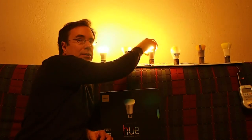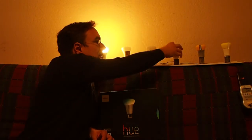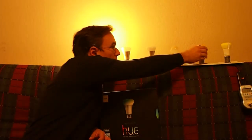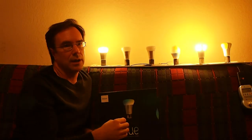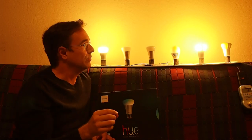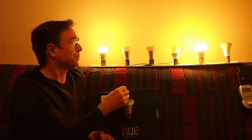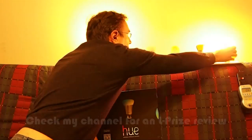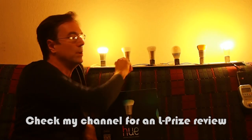Comparing it to some other bulbs: this is the Philips Ambient LED 50-watt equivalent, also an 8-watt bulb — pretty comparable, though the older ambient bulb is a little dimmer. This is the Philips 10-watt, which they call a 60-watt incandescent equivalent producing 800 lumens — you can get this at Home Depot. And finally, the Philips L Prize winner, also called a 60-watt equivalent, producing 970 lumens at 10 watts rated.